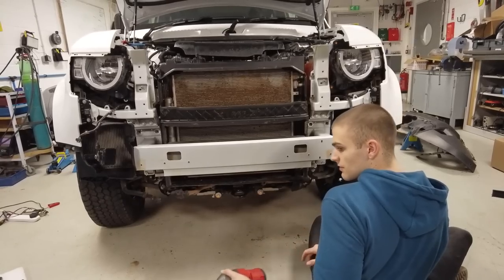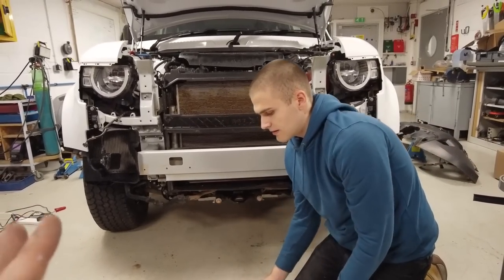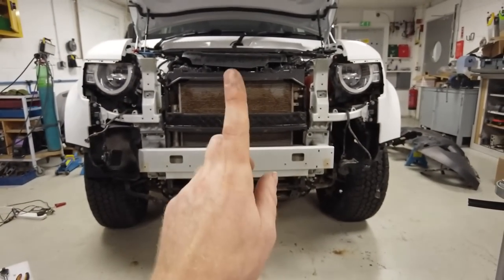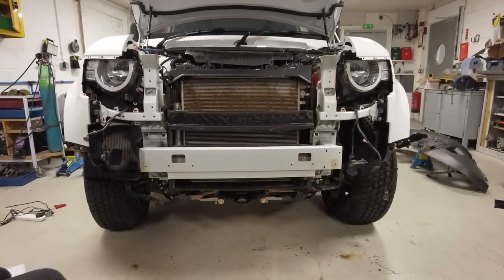Right, put all that down, get it all out your way, and I reckon, Tyler, that's ready to lift off. Now, one tip for those of you who have endured it this far. Before we started, and everyone else will have missed this tip, put your car in the raised suspension, raise it up, and then, because most of your work is quite low, it just gives you a few more inches and makes it a little less strenuous.